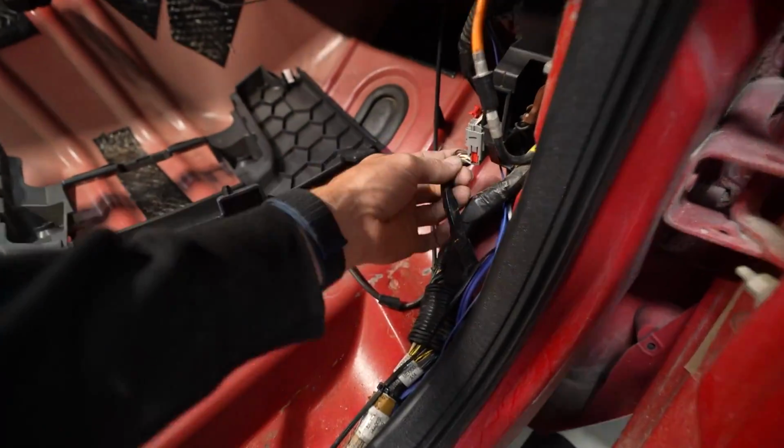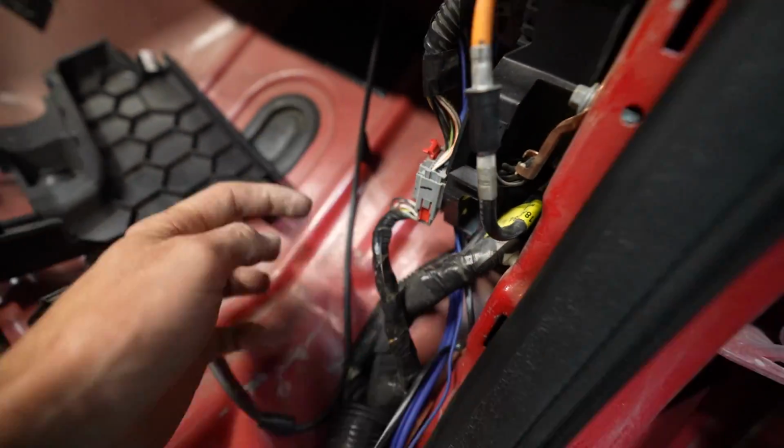You would have to modify that inverter box because it doesn't have the proper CAN signal, but since this does have the proper CAN signal because it is out of a 6.7 truck, everything should be fine. That wire will come right over here. I think it actually taps right into this plug. So I'll go ahead and cut that CAN wire, or I'll splice into that.